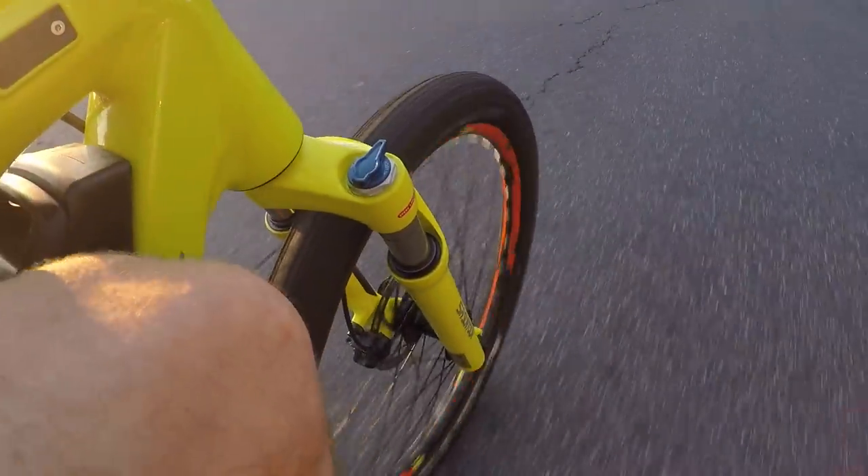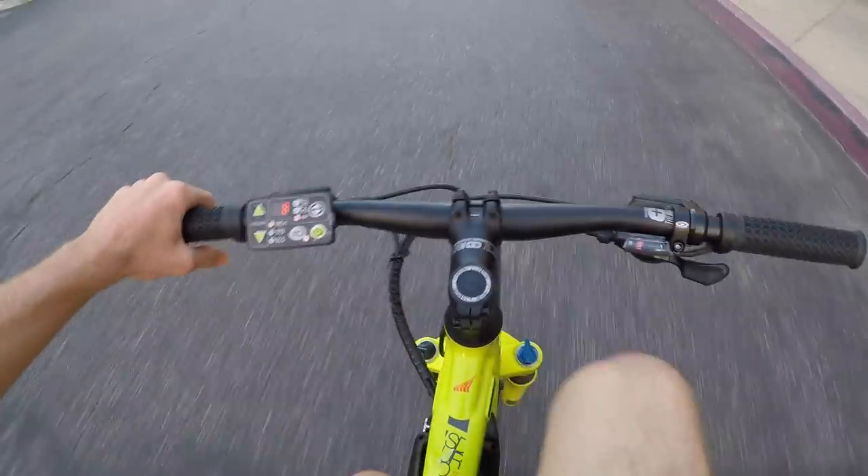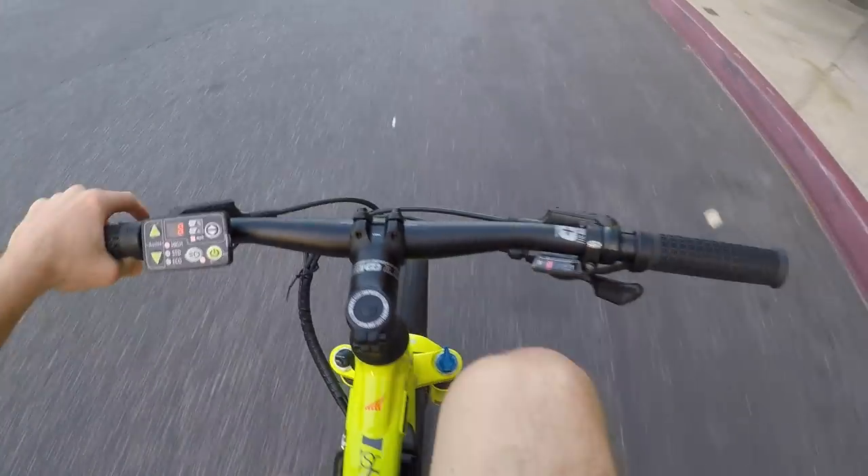The pedal rotation isn't going to get too far and create an imbalance for someone who's younger or petite. Also the motor is listening for cadence, rear wheel speed, and pedal torque. If I pedal gently it's only barely responding, but when I push harder and need that power, it juices me right up to speed. The fork is feeling really good — it's set up for someone who doesn't weigh as much. It's a little bit less stable because of the smaller diameter wheels.